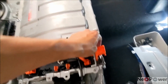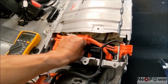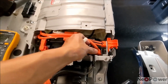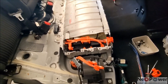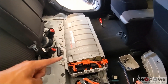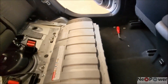While you're at it, take out the plug — this is for the service plug. Another one — I believe this is for the temperature sensor. Oh sorry, this is for the fan, the power for the fan. You might want to release the fastener from below. Now you have all the wiring taken out. It's time to detach this battery from the car. It's held on by five 12mm bolts — one, two, three, four, and another side five. Total five 12mm bolts.